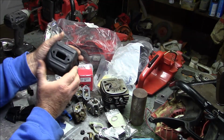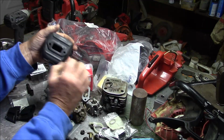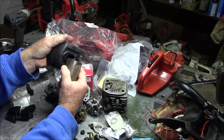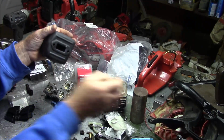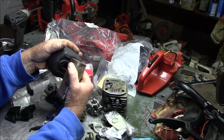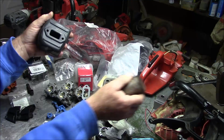And one of the things you'll see with the builds is when they've really chopped that base of the cylinder down a lot, you see these crazy blowdown numbers. And that's because they've had to really change the upper edge of the transfer for two things. One, because you do have that piston interference, you see the guys will really put a sharp angle on the top of the transfer. And what that does is it helps the flow as the gases are coming up from the bottom end, because you have that square edge. By putting the angle on the top wall, you don't have the gases coming straight into the piston. You have it come at an angle and it's a little bit less resistance. So that's one of the tricks you'll see.